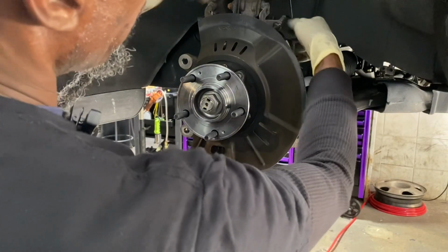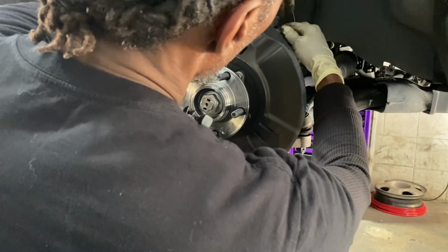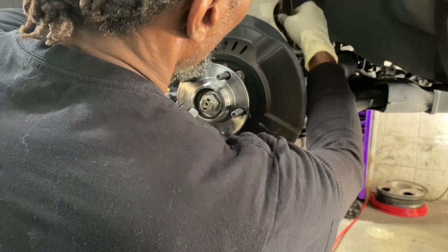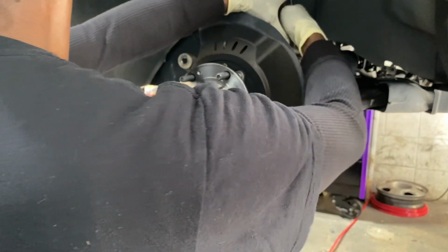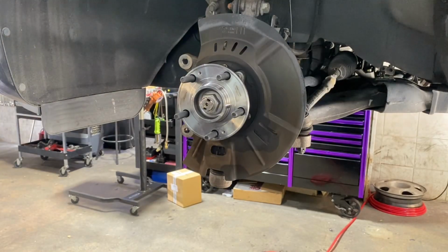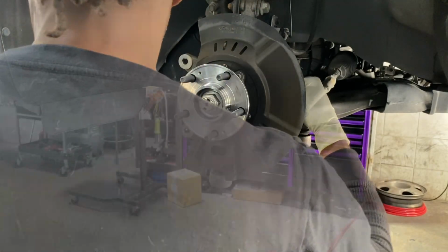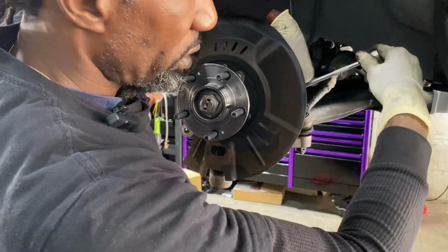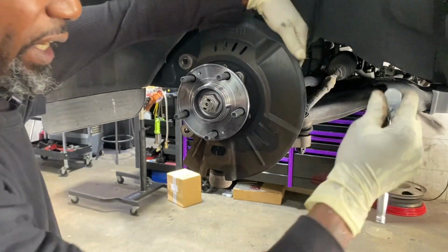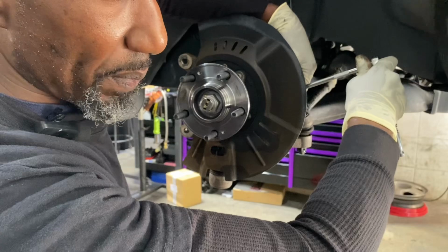Before the rotor, this guy here. Put your sensor back. Put your bracket back. So this was a 12. Okay. Now you need a 10 millimeter on your sensor. Nothing more than hand tool. You can't see it, but I am using my 1/4 inch ratchet with extension. When it stops, I'm done.